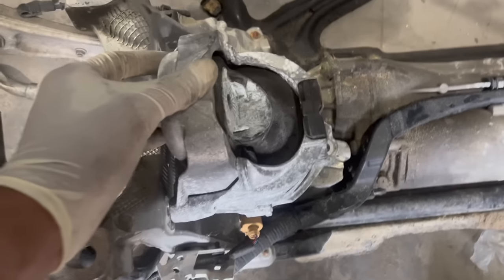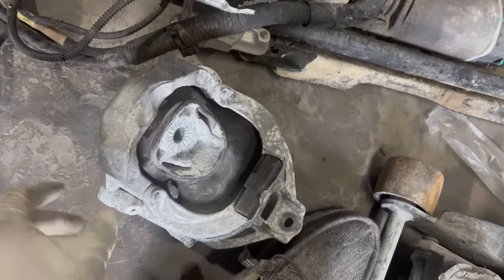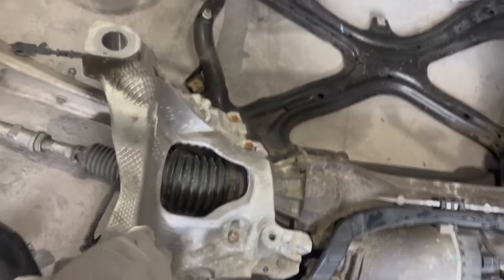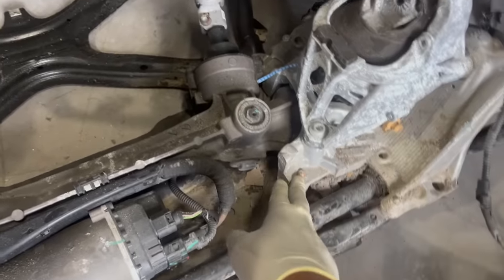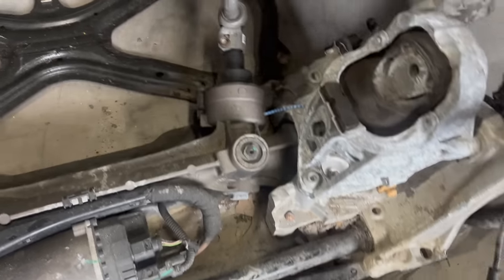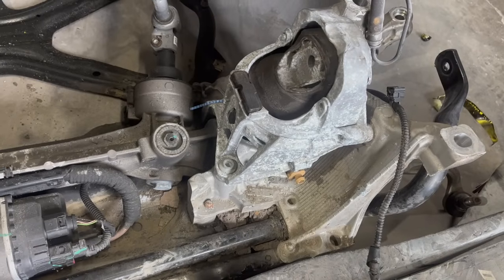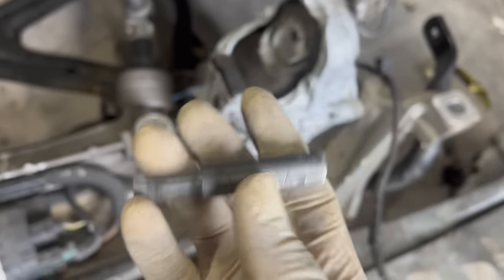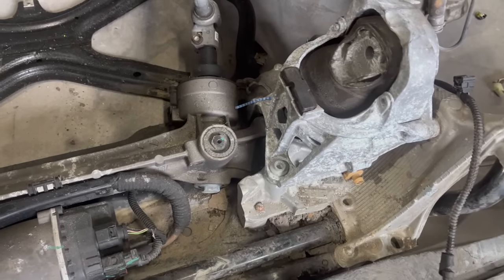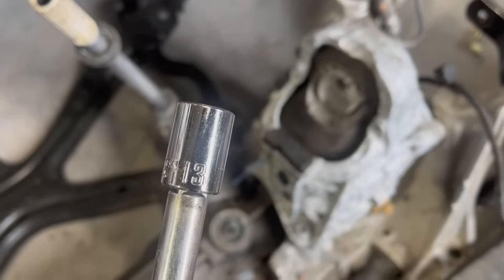As you can see, we have the engine mount arm right there that we just disconnected off the engine mount support bracket that's still connected to the subframe. As you can see, there's one bolt on the left, one on the right, and one down on the bottom. I'm pointing right there to show you that a connector is broken. Just to show you how to basically remove it — it's going to be a 10 millimeter star. The other two sides should be a 13 millimeter.